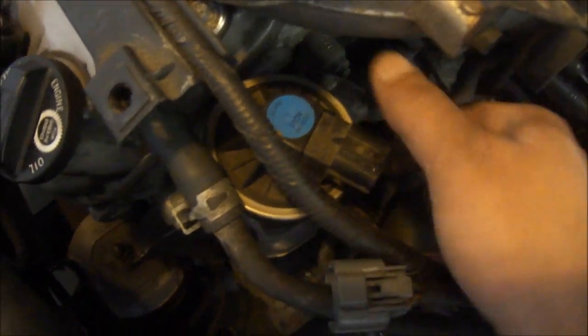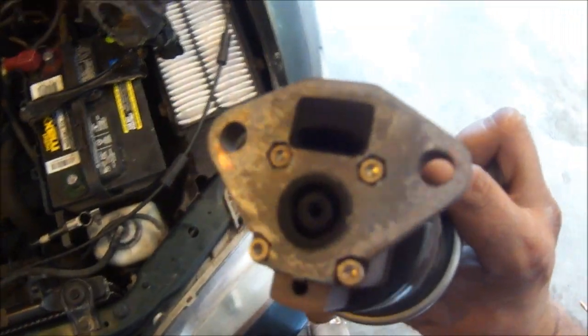I've taken the nut out. I'm just going to pull this open — so here is your EGR valve. What I'm going to do is use a carburetor cleaner to clean this up.